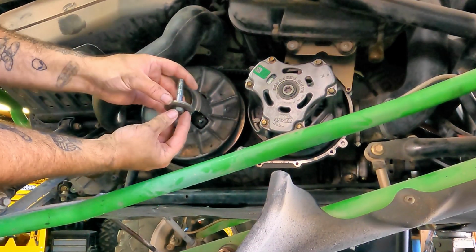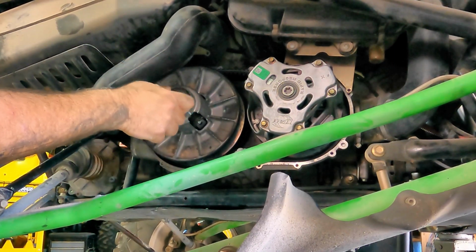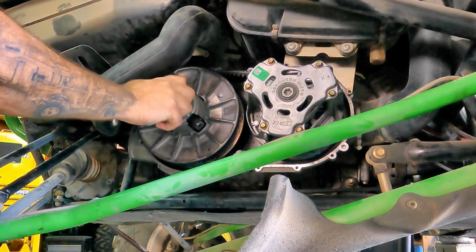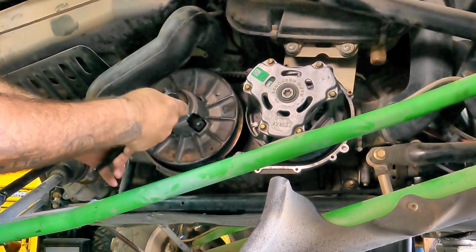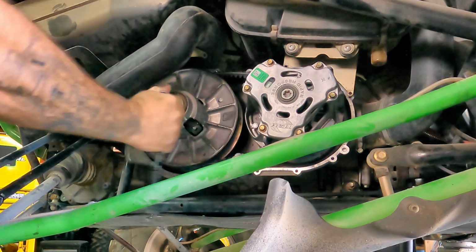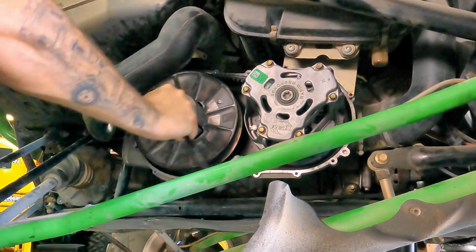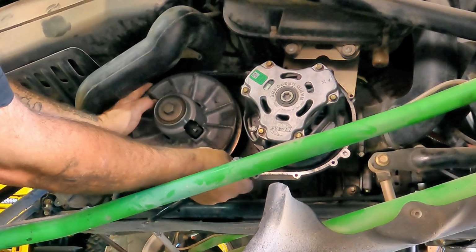We've got our bolt with all the shims. And I'm going to go ahead and install this using a tool that I know I'm going to have on the trail, and that's just a 3/8 ratchet and 19mm socket. Okay, and that goes all the way down. That's nice.